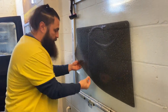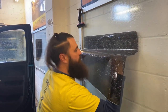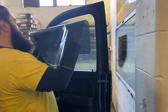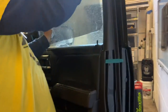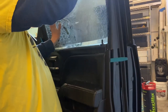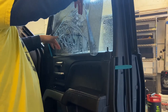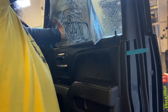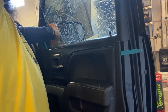I don't like touching the film itself. So I come up under here and just let it sit right on my hand — I have not touched the sticky side of the film. With this blade tool, window film's super thin, it doesn't take a lot. As I'm pushing down, I'm actually pulling on this at the same time, so I can still use my left hand to pull that seal back and to position the film.